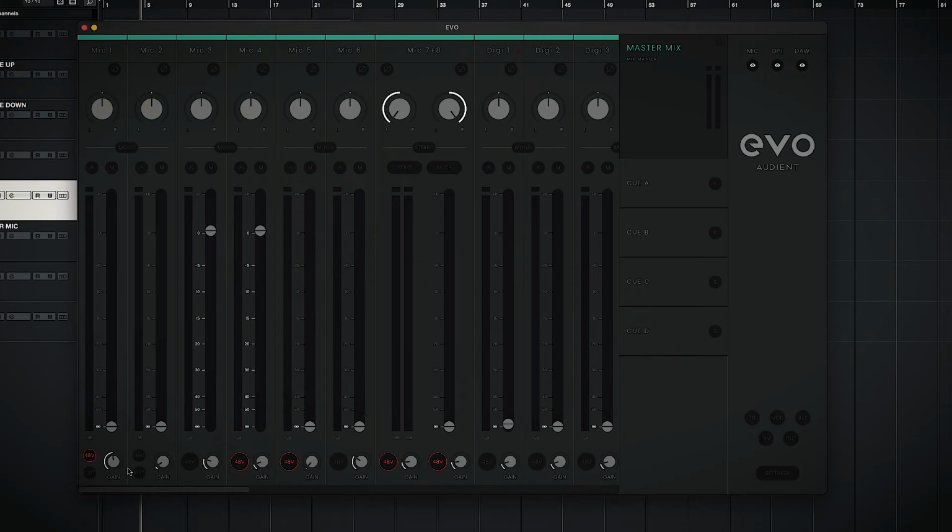You can also set the gain of the mic pres from your computer in the software for the Evo interface. And I haven't tried this, but theoretically, you can use USB cables up to 5 meters when working with USB 2. So theoretically, you could use this interface like a stage box on the floor at the drum kit. You can sit in a room next door, just pull that USB cable in there, and set the gain and everything. If you want to be the engineer and have a drummer playing, you can set the gains and stuff from the other room, just sitting with your computer and get that done.